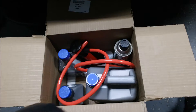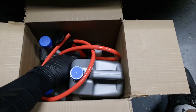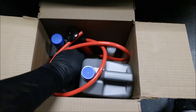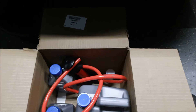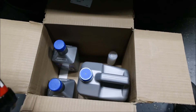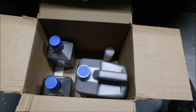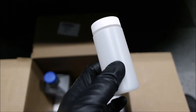You're going to need a can of brake cleaner just to clean things up. You're going to need some crush washers — my manual says to replace them. You'll also need a fluid transfer pump; alternatively, you can use squeeze bottles from Amazon. I'm also going to send the fluid off to get tested through Blackstone Labs — I'll leave a link in the description. Essentially, you let about a third drain out, grab the middle third for the sample, then let it finish draining.